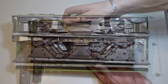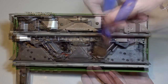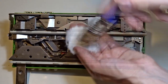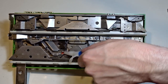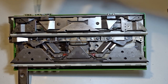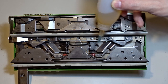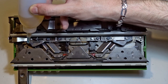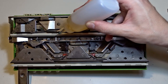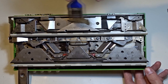Now I will clean the front lock. Follow the same steps: first remove the dust with a clean and dry brush, then clean the brush from the dust and take the pump — the air will blast the remaining dust particles. Now let's lubricate the lock. You can use any silicone-based oil that is safe for plastic parts, or use Bellador oil if you can find it in your area. The locks mustn't be oily — there has to be just a thin film of oil to protect the metal parts from corrosion.